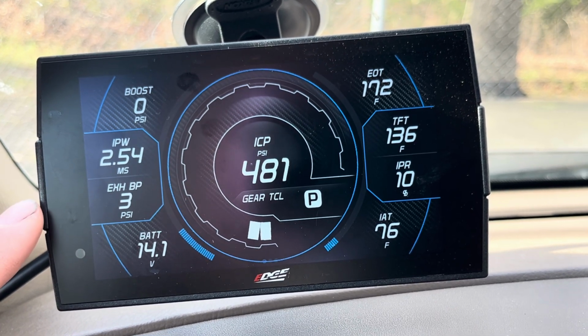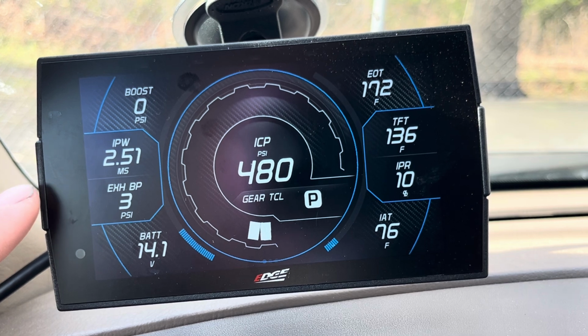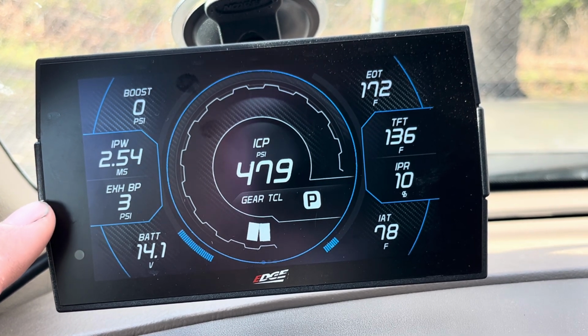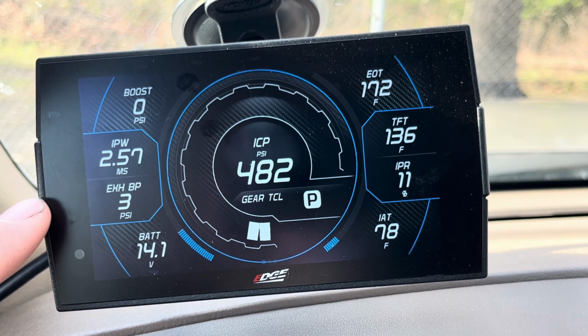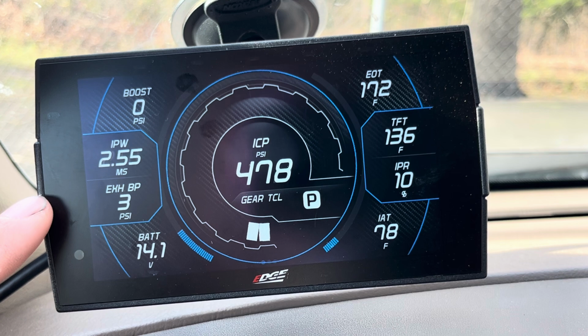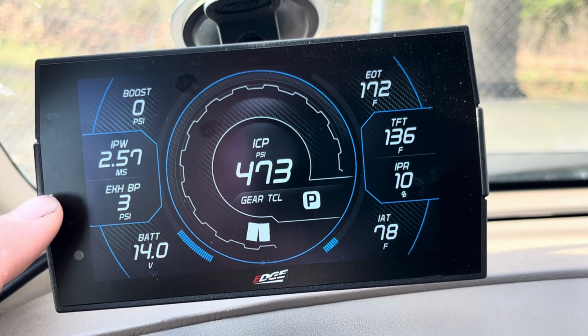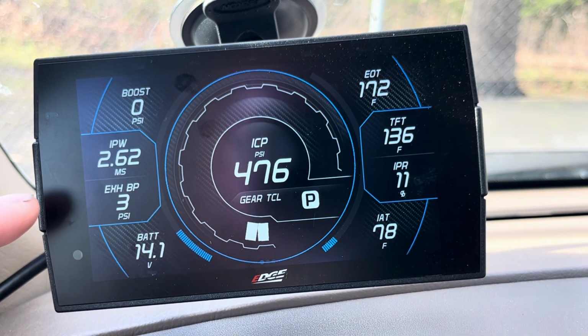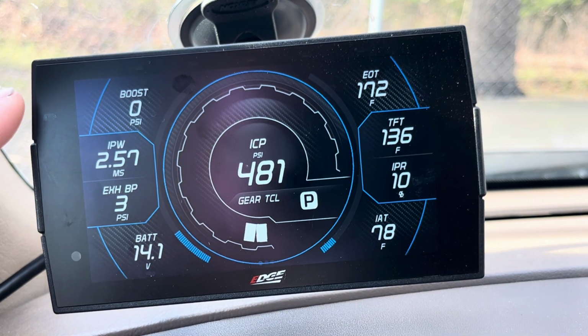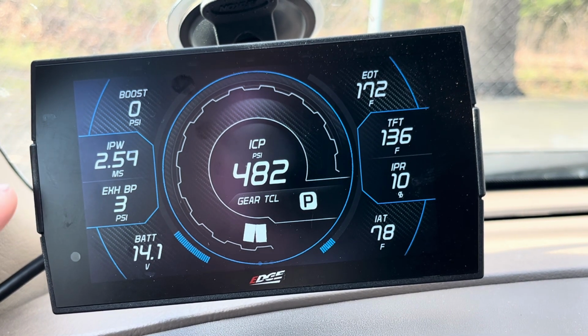Exhaust back pressure, often overlooked. People will tell you can delete it. Do not. It can affect everything from cold starts on your truck to the truck's ability to idle to even your fueling tables. It has a lot of things that it takes into account. The computer, the PCM, takes this number into account, in coordination with boost pressure.